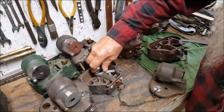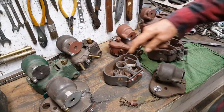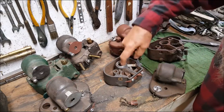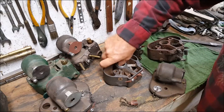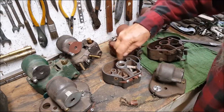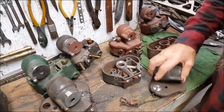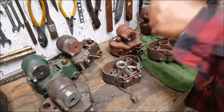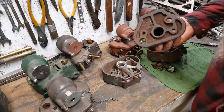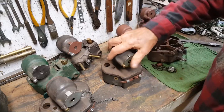The bottom of this right here fits the smaller hole in that mixer right there. It forms a taper — you can feel it's pretty even. If this is a loose fit in a mixer you need to put some gasket sealer around there before you put it down, because it can actually suck air if you don't use gasket sealer on your gaskets. The top part is larger to meet the larger size to go on there.